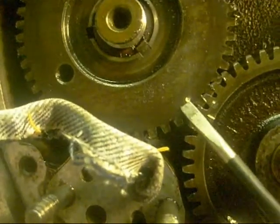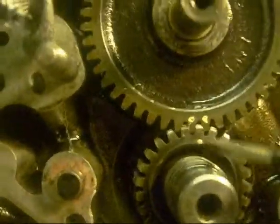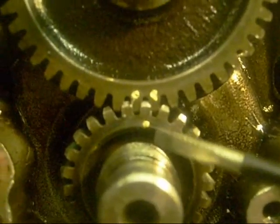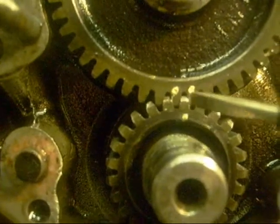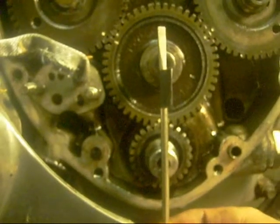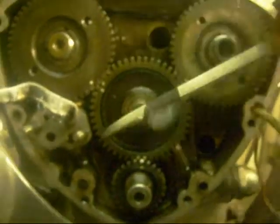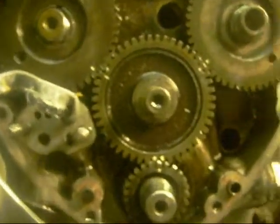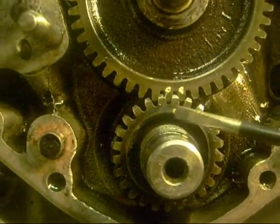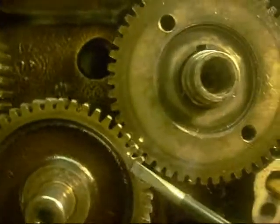That's the same on your crankshaft. These are a pain because when the nut's on you can't see the dot, but the keyway is above the dot. So technically all your keyways point to that pinion — they all point like that. You've got two dots on your pinion lined up with a single dot on your crank pinion.